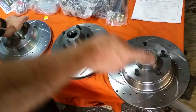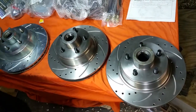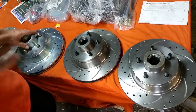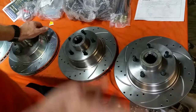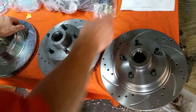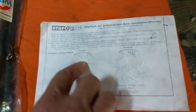Check whether it's got any wobble or thickness variation — that's how you check a rotor. This old stuff out on the internet, on forums, about left and right on drilled and slotted rotors and how that could make a noise or clanking sound is absolutely absurd.